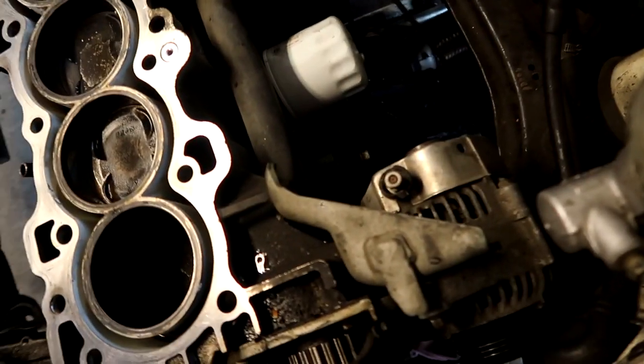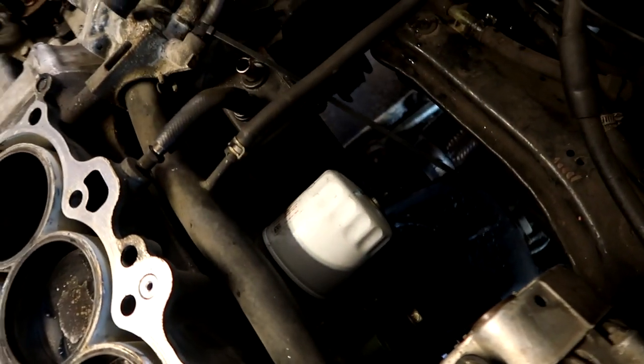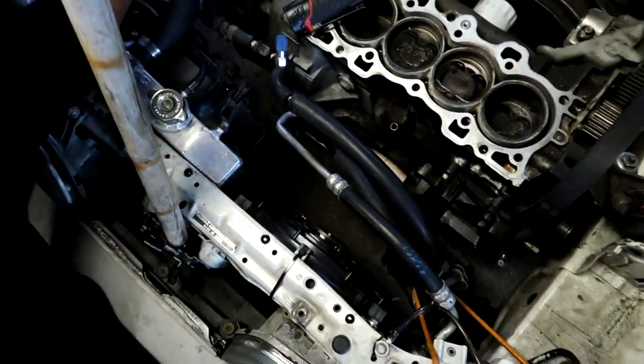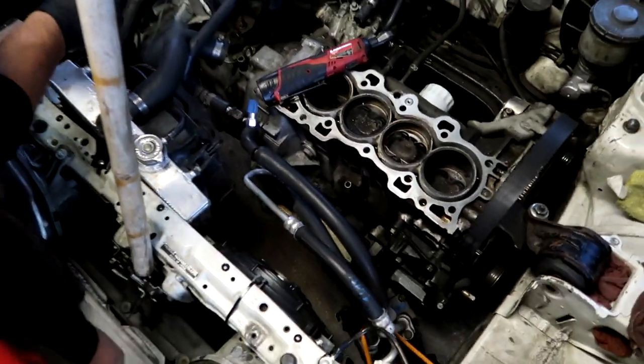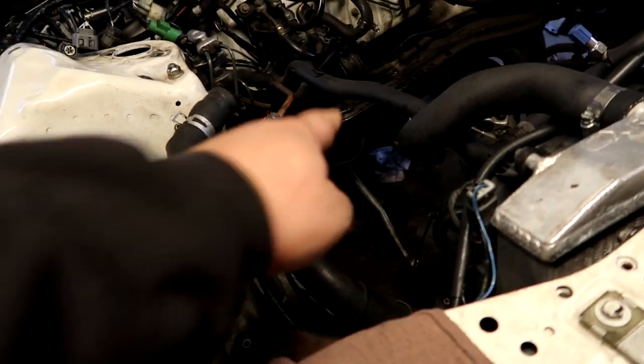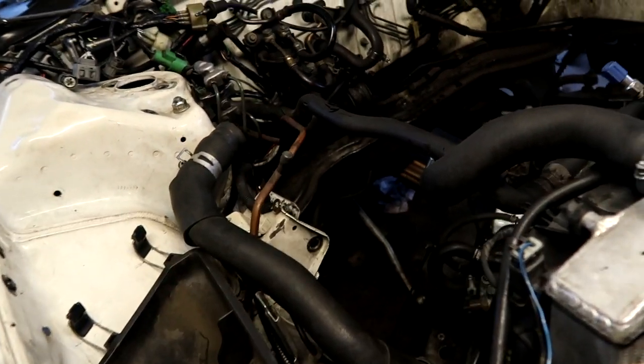The studs are on. To avoid getting stopped on our tracks, I decided to just cut the header off the flex pipe and exhaust system because the muffler shop did some questionable work. Good old-fashioned underneath the car with a miniature dolly because I don't have the big one available right now. It's so much easier without the cylinder head because we don't have to jack the car super high. The way I jack the car up super high is to go right under the shift linkage with a big block to lift it up.